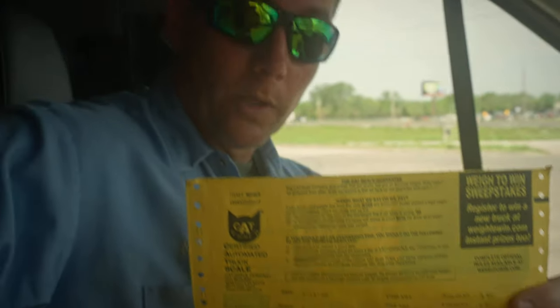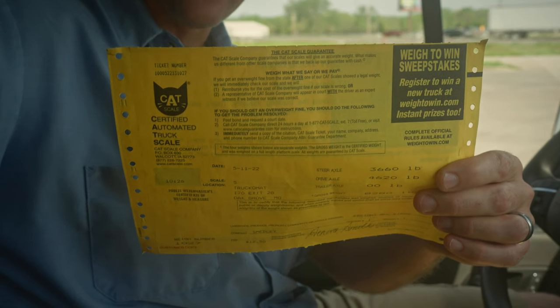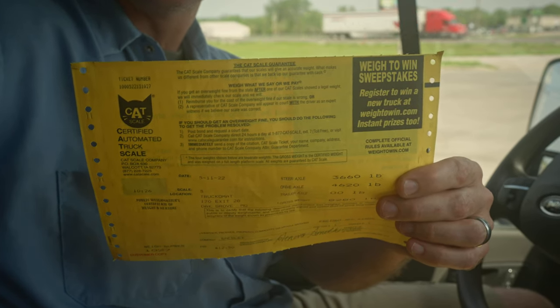Combined weight rolling right now is 8,280 pounds, which is a 1,940 pound increase. All of our shelving, all of our tools, all of our parts and pieces and equipment and everything weighs just under 2,000 pounds, 1,940 pounds. For comparison, the gross vehicle weight rating of this E-Transit, it's a 350 chassis, is 9,500 pounds. So we still have 1,220 pounds of cushion that we can have on the vehicle overall.